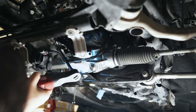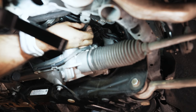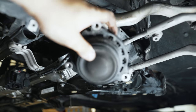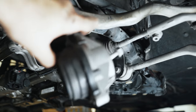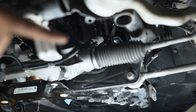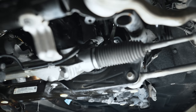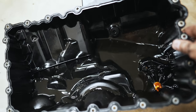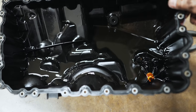To get the subframe bolts, we have 18mm at the back and E14s up at the front — total of six. I'm going to lower the jack now and lower the subframe. Subframe is just hanging by the suspension, which is perfectly fine. We don't have any stretched harnesses or anything. We're just creating enough room to be able to pull the oil pan out. I'm going to disconnect the oil level sensor and go after the bolts on the oil pan — all these are E8s. There are lines bolted to the pan. You have to wiggle it and really fight to get the socket on the bolt. I completely removed the driver's side motor mount because I won't be able to get access to one of the bolts on the oil pan. I loosened the arm as well. I went to the top and used a long extension with a universal joint to slack the top two E12s and completely removed the bottom two E12s just to get access to that last bolt on the oil pan. So there's the oil pan removed. This engine had very little oil in it — I barely drained any out. No metallic shavings or anything caught in the filter, thankfully. So the engine is saveable.